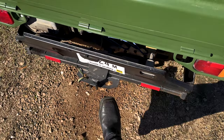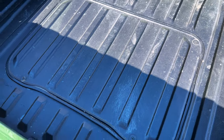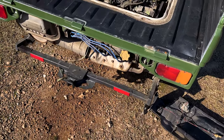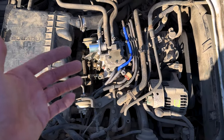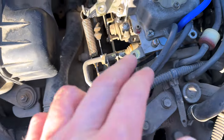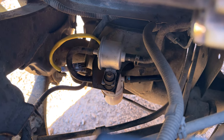First things first, we need to get off the tow bar so we can get the engine compartment door open, and take the top engine compartment handle off. It looks like we have to quick-disconnect the rear engine cover rather than remove the tow bar because it is bolted and welded in. We have access to the front and top of the engine, and also the side. We see a new solenoid on the carburetor, some nuts and bolts have been turned, vacuum line replaced. He said the fuel filter and fuel pump had been replaced. We're going to pull that line off, turn the key on, and see if we get a prime of fuel.